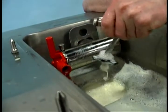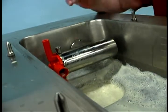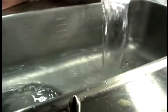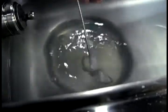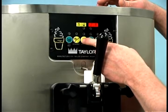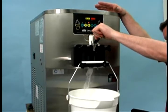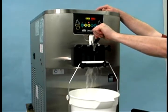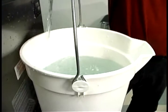Remove the assembled air mix pump and take it to the sink for further disassembly and cleaning. Next, pour two gallons of cool, clean water into the mix hopper. With the brushes provided, scrub the mix hopper, the mix inlet hole, and the mix level sensing probe. Then, with a pail beneath the door spout, raise the prime plug and press the wash key. When a steady stream of rinse water flows from the prime plug opening in the bottom of the freezer door, lower the draw handle and drain all the rinse water from the freezing cylinder. When the water stops flowing from the door spout, raise the draw handle and press the wash key to cancel the wash mode. Repeat this procedure until the rinse water drawn from the freezing cylinder runs clear.